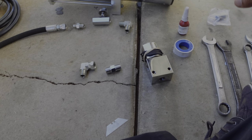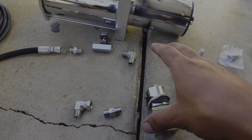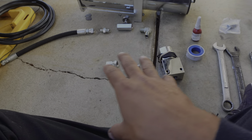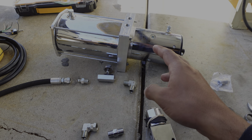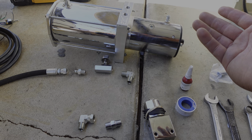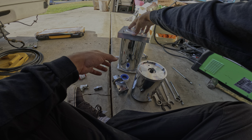Here I have just about everything that we need laid out — a couple of tools and a couple of fittings. Everything here is from Hoppos, so I'm using pretty much everything that Hoppos gave me with their kit. I might change a couple of things out in the future. Since I'm building a four-stage rack I need four pumps. I purchased a Z rack kit which comes with three pumps and four cylinders — two for the dump, one for each side — and then a basic dump kit with one pump and two cylinders, giving me six cylinders and four pumps total.